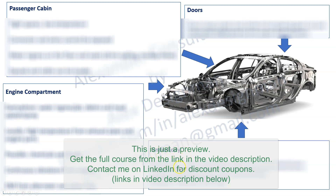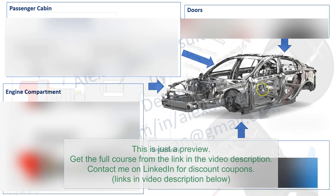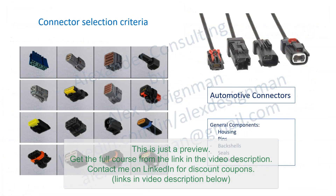On the underbody, you again face water ingress, jets, debris, mud splash, and locally high temperatures from exhaust pipes. Those are the main factors to consider when selecting connectors for automotive harnesses. Always remember the relationship between connectors, wires, pins, and the current and voltage in the circuits — that relationship drives the selection. Everything else is external. We'll continue to explore this in the next videos covering wires and other components.